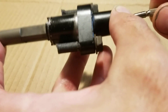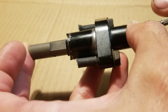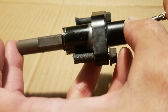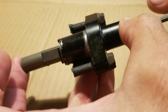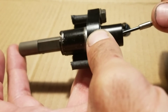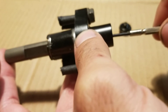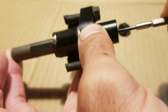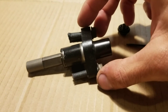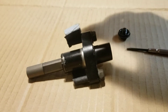When it's on my bike — my 96 KLR — I probably have about that much tension left. I was getting a little bit of chain slap, probably because the spring is not as strong the closer it gets to fully extended. I found that the slap would go away if I just put it on the bike, let it go to its full extension against the cam chain guide, and then give it a little tight turn counterclockwise. That would tighten up the tensioner and stopped what I thought to be cam chain slap against the top of the valve cover.